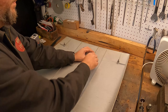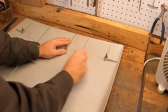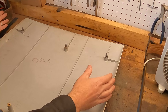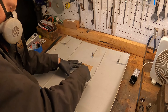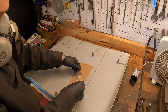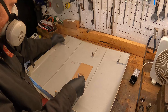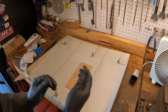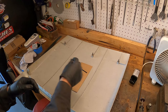The inner studs are in pretty good, so I'll leave them alone and just scrape off some of the sealant — Ford did put a little bit of putty around there to keep moisture out of the holes. Mixing up more epoxy — mixing it well — getting a nice glob in there. We'll let this dry, come back, finish up these two holes, and we'll be done with it.